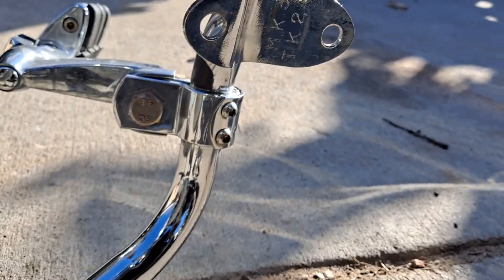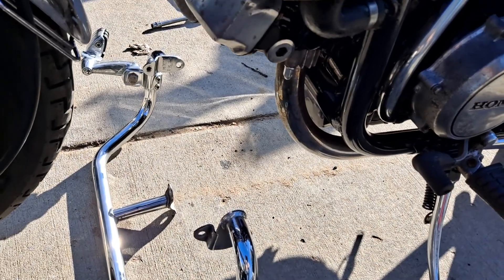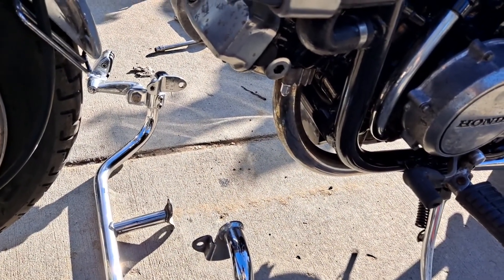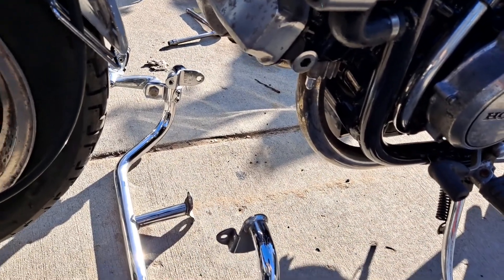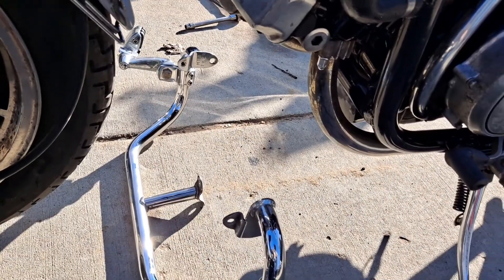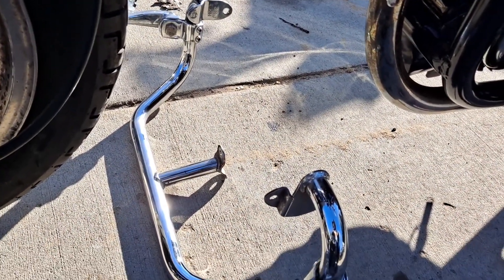But you can tell because the Honda OEM ones — the genuine Honda ones — will say this on one side. They will be stamped MK3. That is the code for the 85, 86 Magna 700s. I believe it's MB0 or MB2 for the earlier Magna 700s and some 750s — the 82 to 84. If I'm wrong, I will say so in the description. I'll also write down this one in the description so you can see them all side by side. And I do have other videos on the other Honda OEM ones for the other years of the Magna.